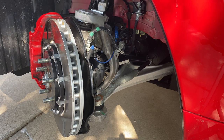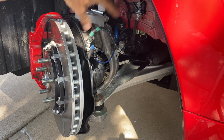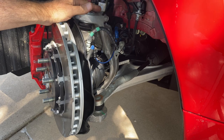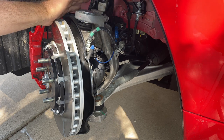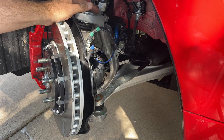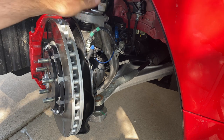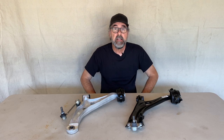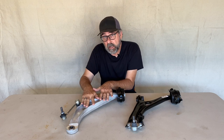As you can see there's a lot of aluminum here — what they call the fork, the upright or steering knuckle. Normally this is one piece but here it's two, and the lower control arm itself. Those are all steel or iron in a normal Civic, so it looks like they're trying to reduce unsprung mass. Now's a good time to show you these pieces off the car — I've got some of them on a bench so we can look at them in isolation. I've always wanted to do visual aids for a suspension deep dive. I've got standard Honda Civic stuff and the Civic Type R's components.